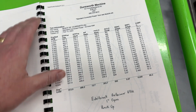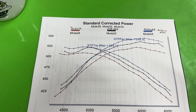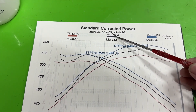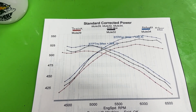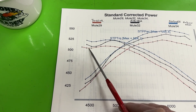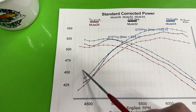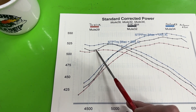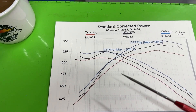Now here's the comparison line graph — also in the book. Red line is the Torque Link, black line is the AFR 4812, and blue is the Performer RPM. Unlike the single planes which were pretty close together, these dual planes are not close at all. The Torque Link is just bad. I expected it to at least have more torque down low because of the long runners — maybe at 4,200 or 4,400 RPM. But it was never better. It only comes close to matching the AFR at one narrow point on the graph.